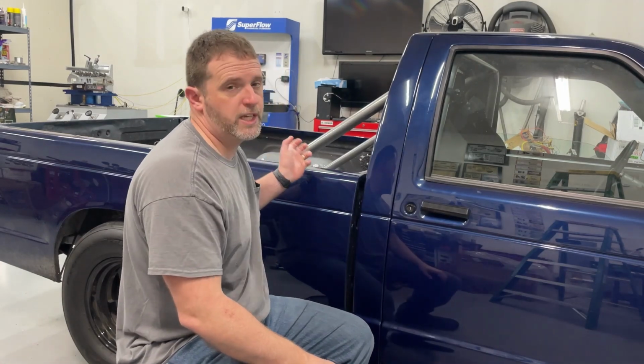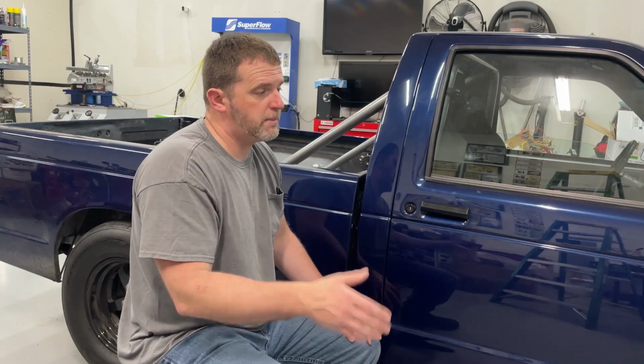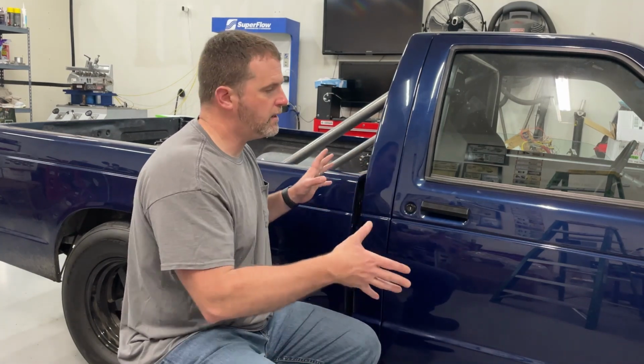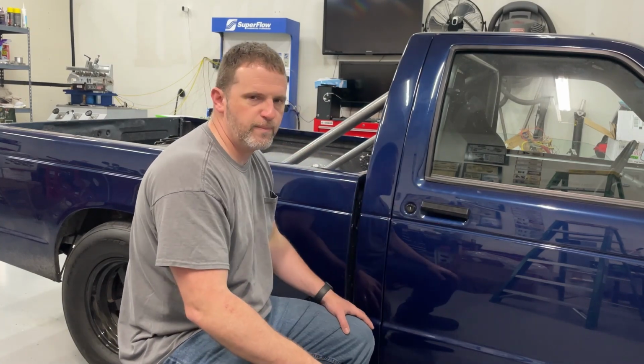It also needs more gear because you should be crossing the stripe, the end of the track, a few hundred RPM more than your peak horsepower, which was between 74 and 75. I should be crossing about 7,800. I'm crossing with the radial 73 and 7,000 on slicks. I'm outside of where it should be. Because of that, it's showing less speed, less ET, and it's not as good.